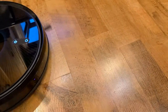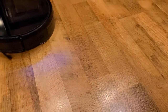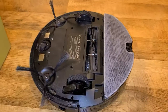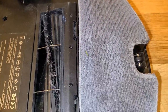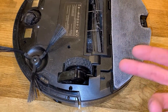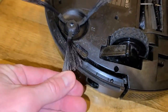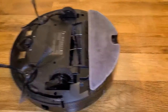Let's take a look at the medium water setting — it is definitely putting out a little bit more moisture on the ground. You can see some beads there; it would probably need to run over that area once again. Medium puts out more water. I'll let you guys play around with high depending how deep you want to clean. Flipping it over after mopping the kitchen, the microfiber cloth is definitely nice and dirty. It's damp to the touch, so don't let it go into carpeted areas — it'll drag water and dirt onto your carpet. Zone that off with the black border strips.